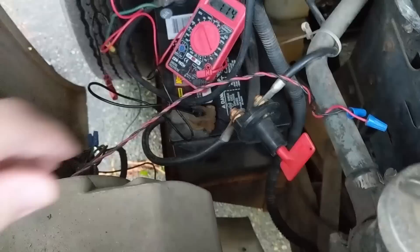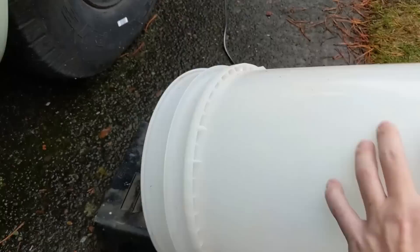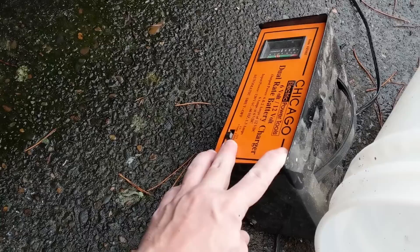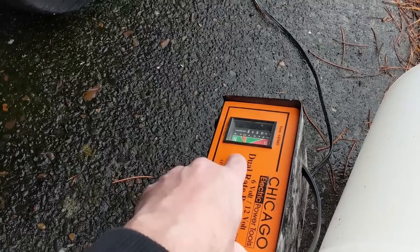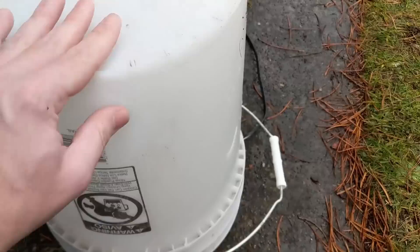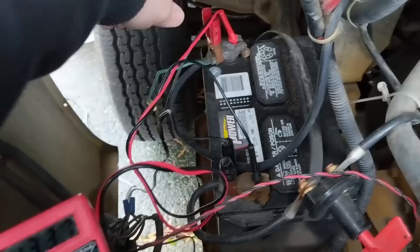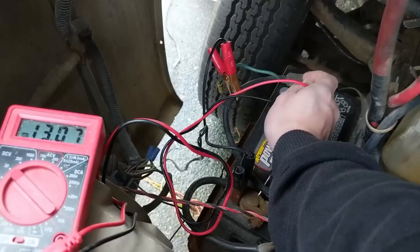It's now tomorrow. You can see it rained last night. I had my charger underneath a bucket all night long so it didn't get wet. I had it on 12-volt 2-amp charging all night and it's sitting in the red. But the battery's reading 13.07 volts after disconnecting the charger — I think we're saved.